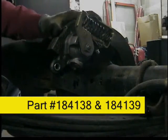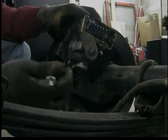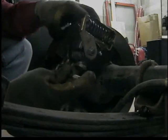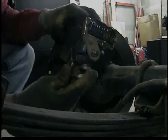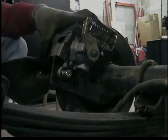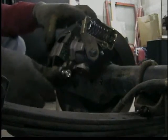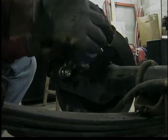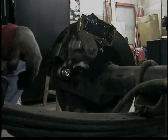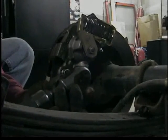Here's my new brake caliper — I used a 1980 Cadillac Seville. There are some other models that use this caliper, but when I ordered it, that's what I used. It came with new mounting bolts. I'm just mocking it up here; I'll take it all back apart since I've got to paint everything. In this picture you can kind of see that spring is what the cable goes through and the bracket that it pulls on.